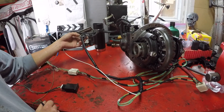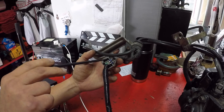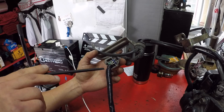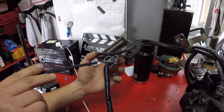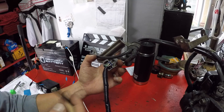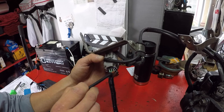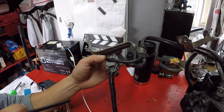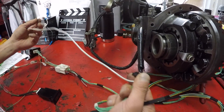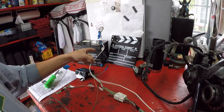So I'll explain the different parts of the wiring to get the actuator working. Starting from this switch that comes out of the actuator, there are six wires. Five of them go to the ECU, and one of them — which is actually just the ground — the two white with black striped wires are two ground wires that you can splice together and that just needs to be grounded to something. As you can see, the two wires that are grounded, I've put a ground wire and this goes directly to this bench test battery I have, going to the negative.